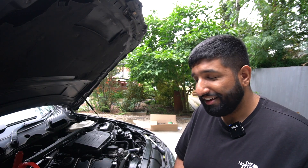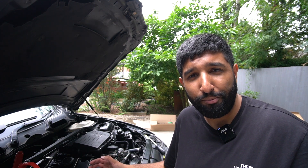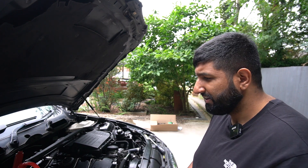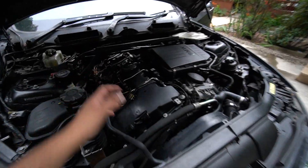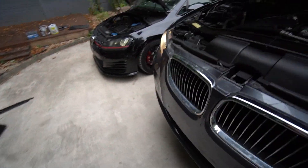Currently in the process of bleeding the system again. You tend to hear a lot of weird toilet-flushing style noises from the water pump, which is quite funny. I think this one's done because it's not making any more noise. This is the moment we've been waiting for since the last video - does it actually run after all these jobs? And there we have it, an N54 back to life. No leaks from what I can see, serpentine belt seems to be all okay, pulleys are working fine, and crucially no leaks below it.